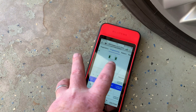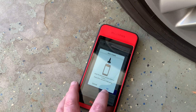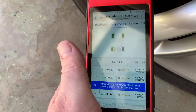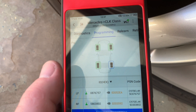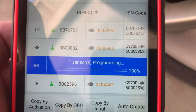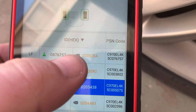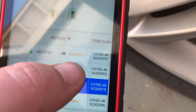Now we're going to do the last one — select it, it goes down to that one, Auto Create. All right, continue. There we have it — all four new sensors are discovered and shown in black. This side here shows all the old sensors. Now I'm just going to reinstall the valve cores.